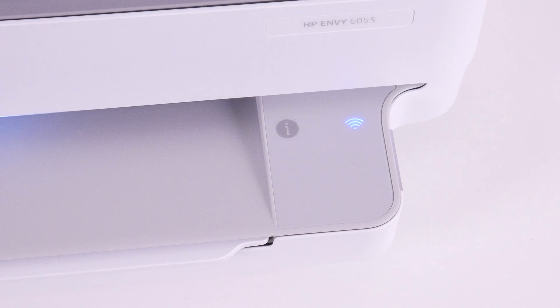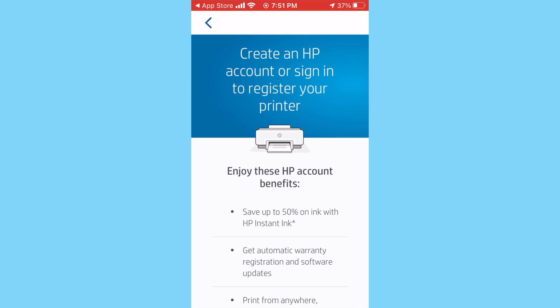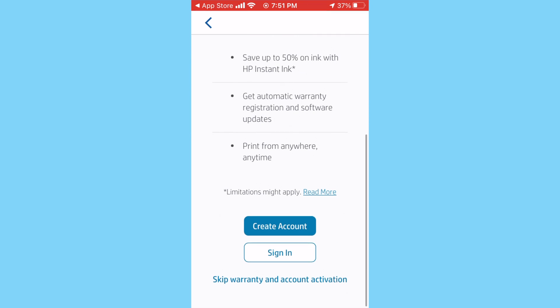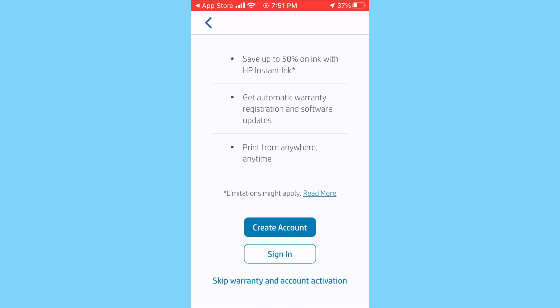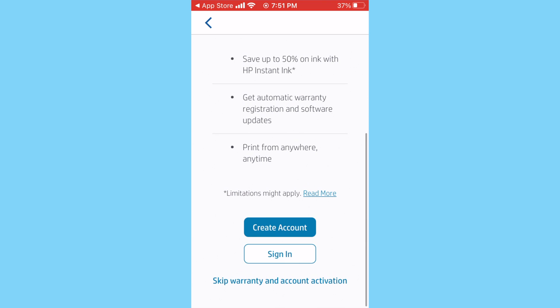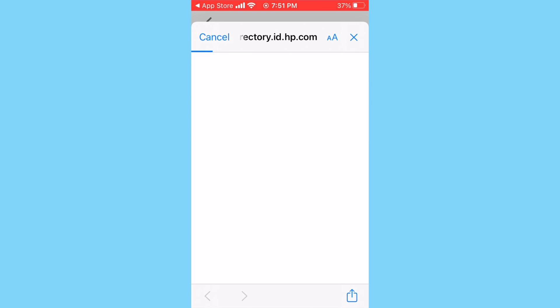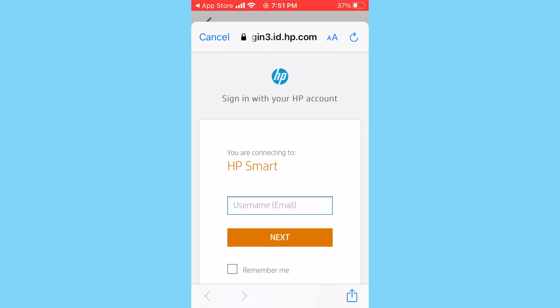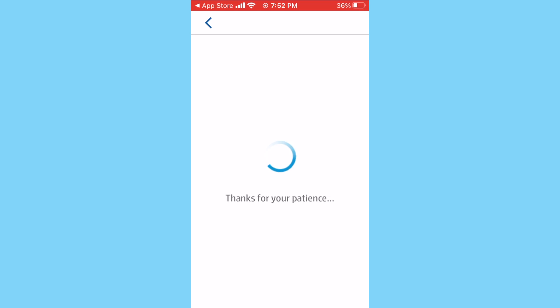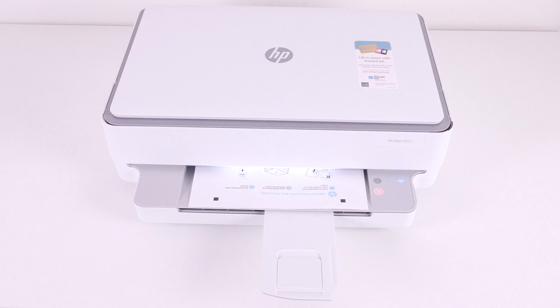On the next screen it asks you to press the info button on your printer — press the flashing info button. On the next screen just tap Continue. Then it asks you to either create an account, sign in using an existing account, or skip warranty and account activation. I highly recommend creating an account or signing in — this ensures you get proper warranty registration and software updates. I already have an account so I'm going to sign in. Once you sign in, it asks you to begin the alignment process — tap Continue.